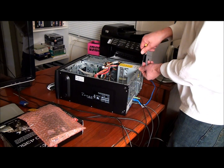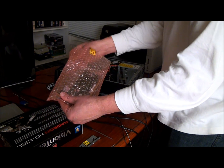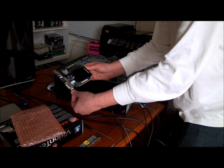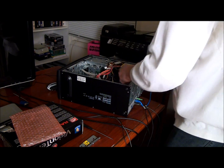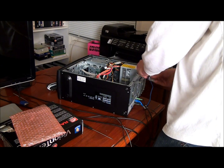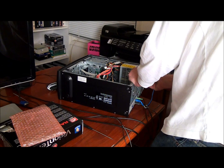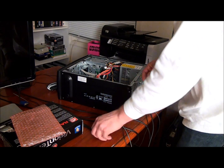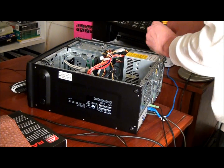On this particular case, I have to pull a little gizmo off here that keeps those cards seated down into place. Here's our brand new video card. I want to ground myself to the case, and we're just going to pop that in there as quick as can be. Bam! That's pretty easy. This just applies a little pressure to the cards and keeps them in place. There we go — we're all ready to put the case back together.